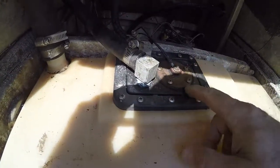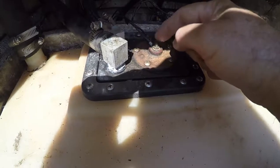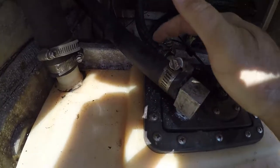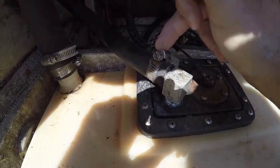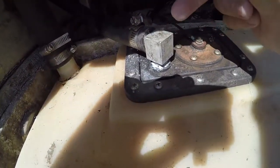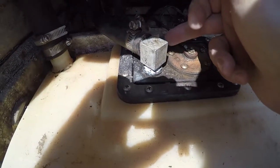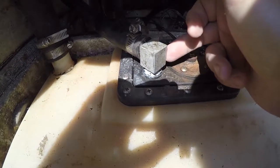The top is on, the connections are on for the fuel gauge sensor, the hoses are hooked up to the vent line and the fuel pickup. I've got a new fuel pickup hose on, stainless steel clamps back on the barb connection into the pickup tube, and both fittings sealed in. It's been sitting for 72 hours with the Permatex Teflon-based sealant from the marine store.